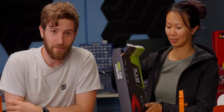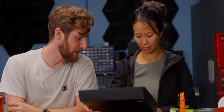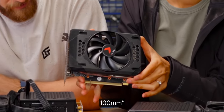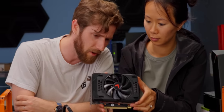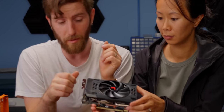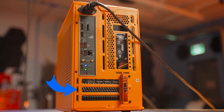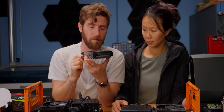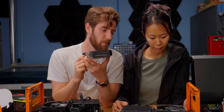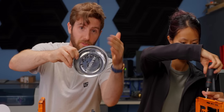We've gone with an RTX 3060 Accelerate from PNY, and the main reason for that is it's tiny. It's got what appears to be a 110 millimeter fan on it — awesome for a tiny little mini-ITX card. All of the IO is in a row, which means we're actually going to kick a substantial amount of heat from this GPU out of the case, though we will be kicking some of it into the case, which means we're going to have to deal with that with some case fans. It's nice that this case uses all the same screws for absolutely everything.